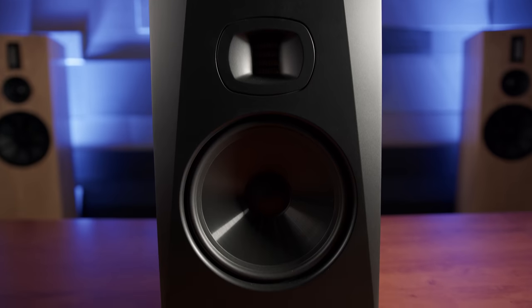The low end detail is excellent, with the front port working well to eliminate most of the problems often heard with front ports — no noticeable chuffing or turbulence apparent. But I did find it quite easy to drive the speakers to a volume at which it sounded like a particularly aggressive limiter was kicking in — not pleasant. Going back to the mid range and particularly the low mids, am I hearing a similar issue to the Adam T8V we reviewed a few months ago? Decent drivers let down by a lack of damping of the thin MDF box and plastic front panel.